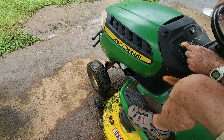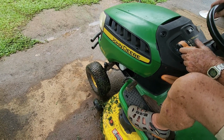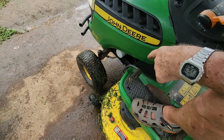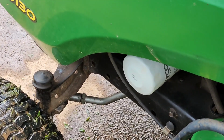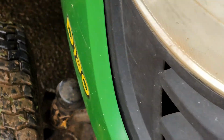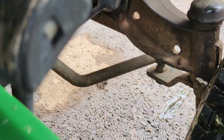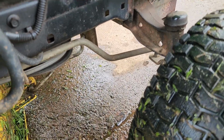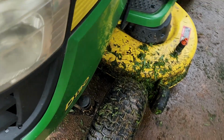A lot of the stuff was irrelevant and didn't really touch on what I was after. But I got a few clues of a couple, and I came out here, and the tie rod end on the steering, there's only an adjustable one, a tie rod end on the left-hand side. The right hand is fixed. Some of the ones I see on YouTube, they were just no adjustment whatsoever. It's fixed length. And then some had adjustable on the right, some on the left, some had both. Ours is adjustable on the left, but whether that's original or not, I don't know.